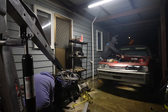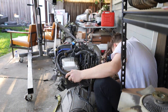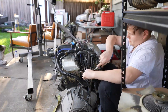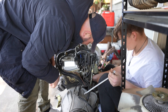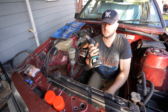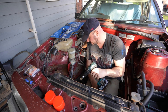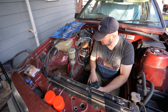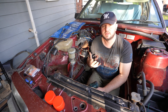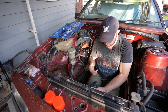Super wet right now, and we're going to get this done quickly. I don't want this to take too long. I'm going to go around with this and just loosen up any rusty flaky paint, then quickly undercoat it and get rid of any rust. All this section here is pretty much under the motor, so we're not going to see it once the motor's in — but just to prevent any further rusting. And then one day, if we decide to go all out on this car, we'll just rip the motor out, clear the whole bay and give it a proper paint.